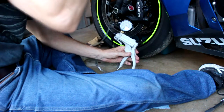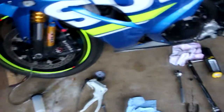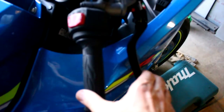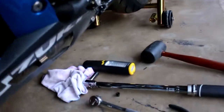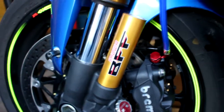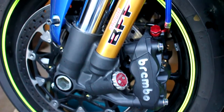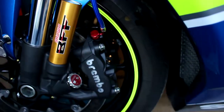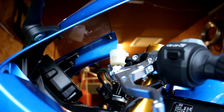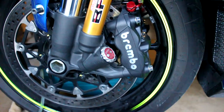At this point I'm going to check the master cylinder and see if the brake lever is really firm — and it should be. The brake lever feels really good. I've been around the whole system about three times and the brake lever is absolutely solid — just rock solid. Now I'll tighten down the bleeder screw and put the rubber cap back on. If you just put brand new brake pads on, go ahead and top off your brake fluid just below the upper level. If you have old brake pads, leave it about halfway between low and high.